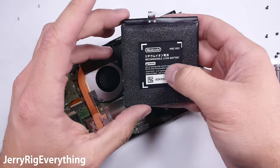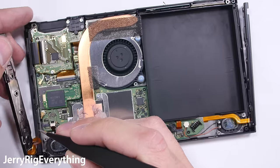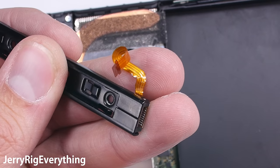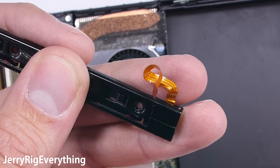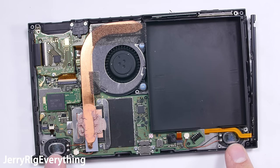The battery is pretty large capacity at 4,300 milliamp hours. The side rails have a small ribbon cable that goes to the main board — this is what charges your Joy-Con controller, so if this ribbon breaks, so does the charger to your controller. And the controllers are kind of important, so remember to be gentle with the Joy-Con rails.